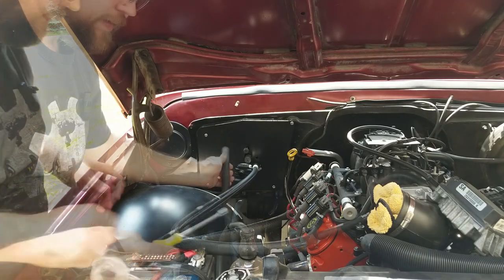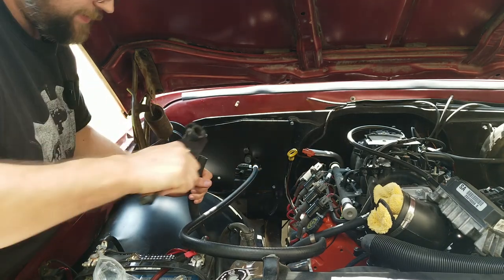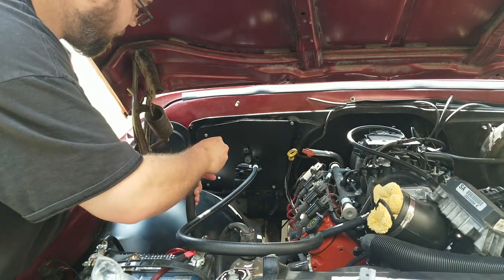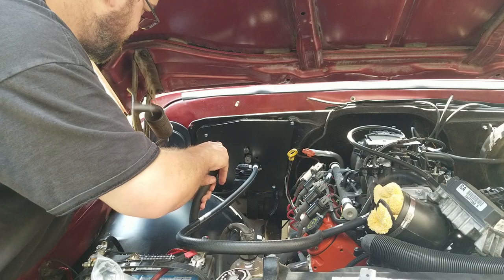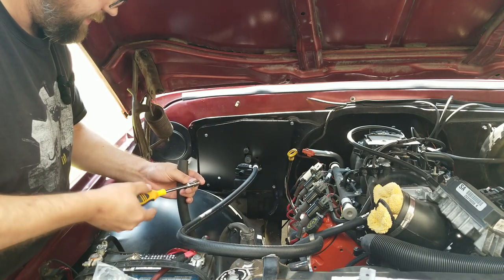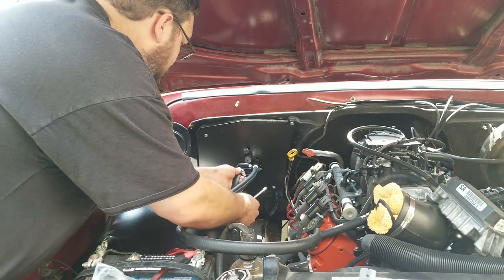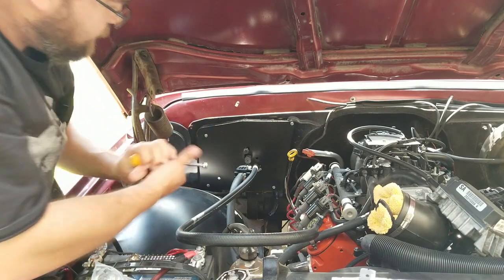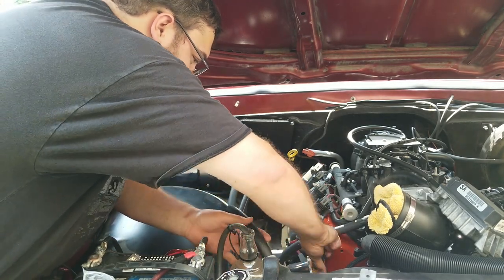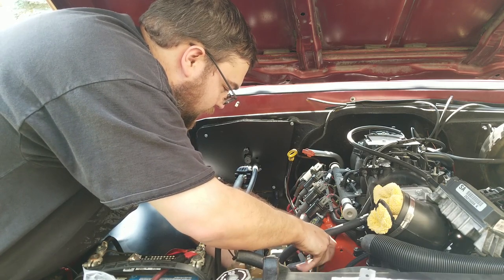I don't like that. I'm going to cut off this part that's been clamped before. These clamped ends of these hoses get all screwed up. They split real easily, in my opinion. Now this is a 3/4 hose, which is not per the instructions. But we'll just crank it down, as one does. All right. So I'm going to take this old hose off, and then I'm probably going to end up taking a shower in coolant, even though I've already drained everything.